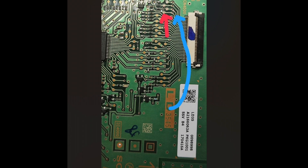At the start of the TV there's a voltage check, and basically this checks if the signal has the same readout as ground. The easiest way to bypass the backlight voltage check is to cut this trace. What I did here is I've taken off part of the coating of the trace and soldered it to the ground right here.